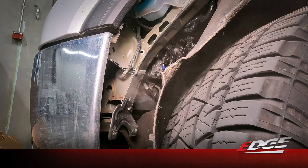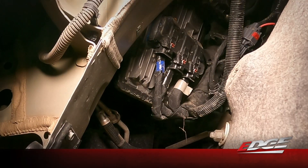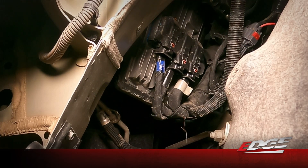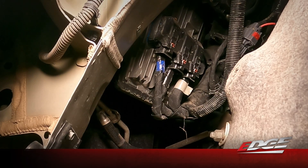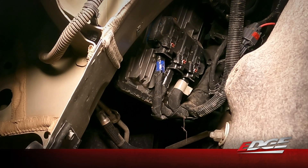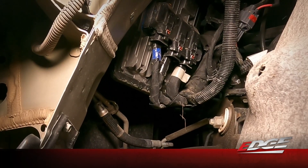Here's our ECM. There are three connectors right there on the ECM. On the ECM unlock harness, you'll have two connectors and then a really long lead with a couple of alligator clips on the end to run over to the battery on the passenger side of the truck. Before we get to that, we need to connect this harness into the ECM. The connectors on your harness are color-coded — there's one blue and one gray. We're going to go ahead and disconnect all three connectors on the ECM.